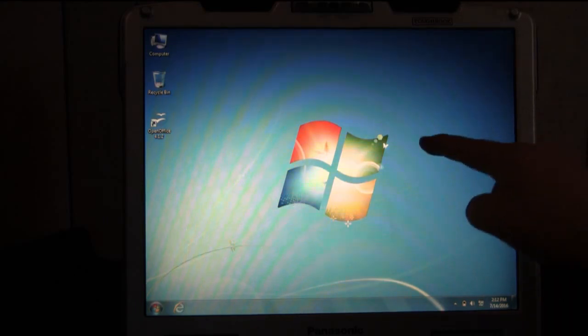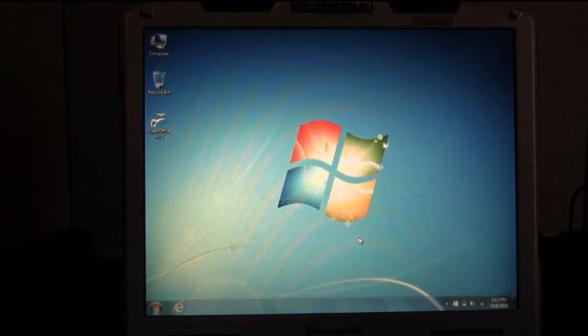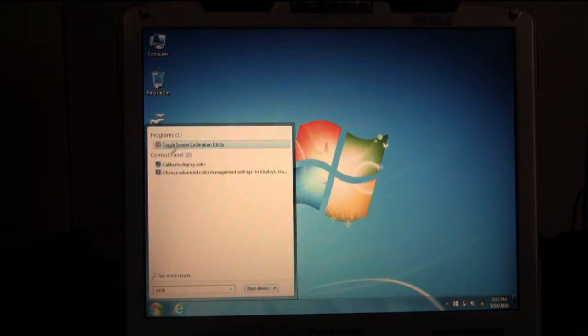It's restarted now and it's in touchscreen mode. You'll notice a few differences — instead of showing up as just a dot where you click on the screen, it'll show up with the mouse icon when it's in regular touchscreen mode. To calibrate this mode, you'll need to use the Fujitsu calibration tool. The quickest way to get to it is to press the start button, click in the search bar, and start typing 'calibrate.' It'll show up right there — it'll just say 'Touch Screen Calibration Utility' with a little gray symbol with a red C in the center.